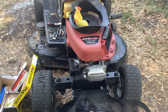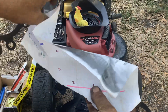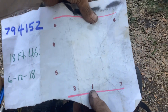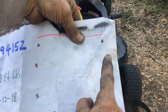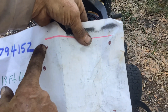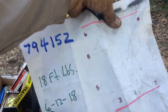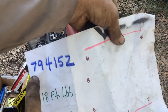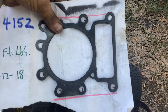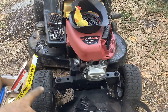Back to the sequencing: you're going to start in the middle bottom — that's number one. Two is right above it. Three is this corner. Four is up to this corner. Five is here. Then jump up to six at the very corner. Seven is down to this corner. Then eight. So you do this in eight bolts across three sequences: 6, 12, and final torque of 18. You've got a straight line with three on the bottom, three at the top, and two odd-ball ones behind the exhaust pipe.